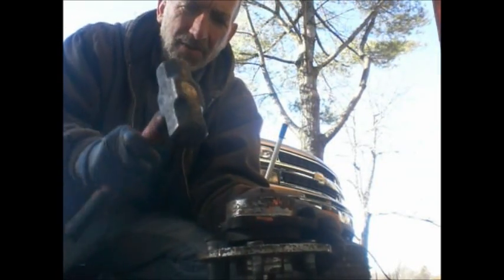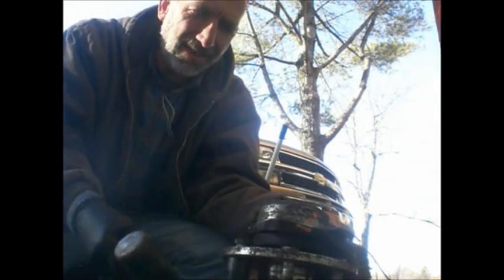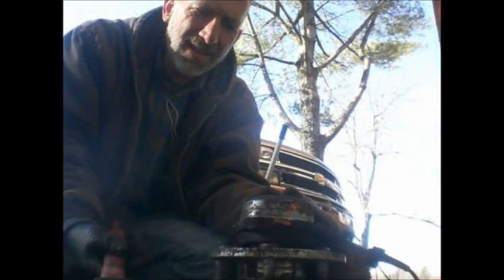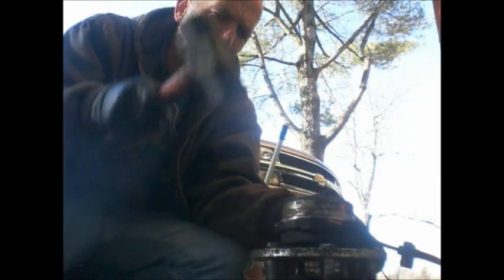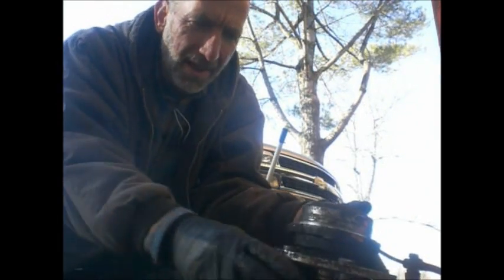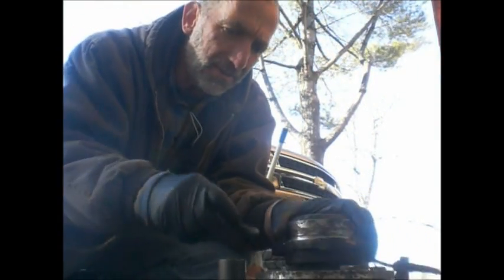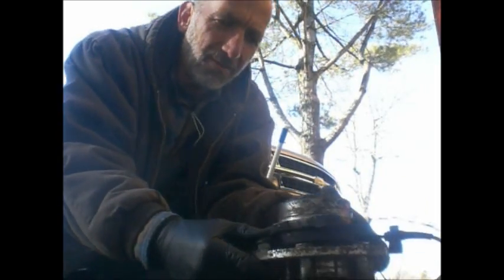And on the vehicle, I guess you have no choice but to use their special nut. Looks like a backwards nut. But I've never used that backwards nut, but I've used a few washers, and the washers actually break. Yep, breaks the washers. Like I said, the best way is off the vehicle, in a press, if you can. This is the second best system. Make sure it's all the way down, because when you tighten your wheel nut, you're eventually going to get some looseness. Sometimes you can't get to the top of it because the flange may be in the way.